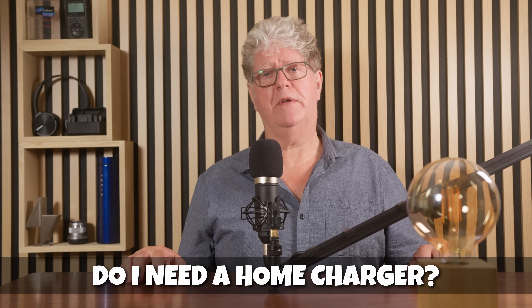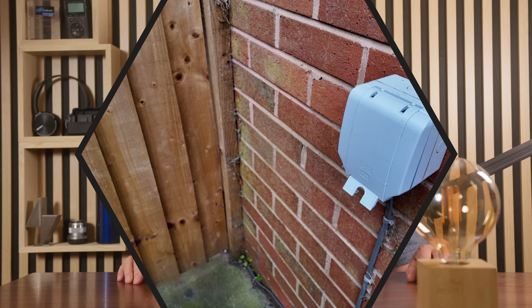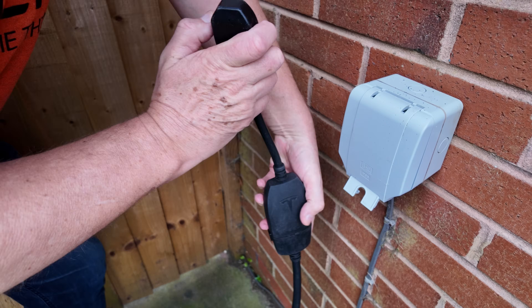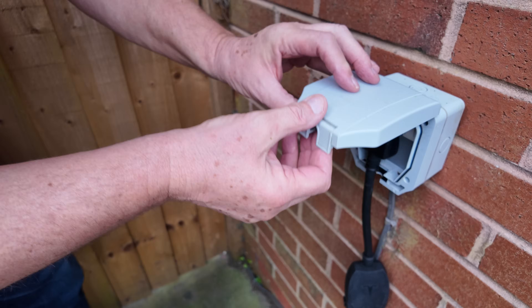So do I need a charger? If so, which one? Well, the great news is that all EVs have a battery charger already built in, and the majority of manufacturers will provide you with the specialised cable to allow you to connect your new EV to a standard 13 amp 3-pin socket. All EVs can be plugged into a standard kitchen or garage 13 amp socket — nothing really could be that much simpler. The reason some people do not use these is that it's slow. These sockets in an average house are not designed to run flat out at 13 amps for many hours, so your charge is going to take less power to be kinder to your house, and it might take hours to fill it up, particularly if it's nearly empty. Luckily, most of us do not let the battery get empty.